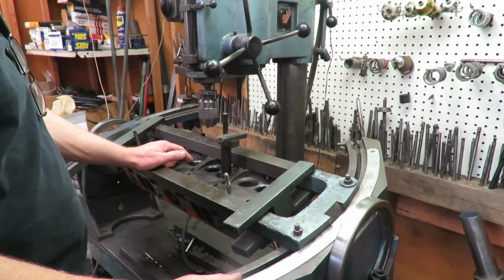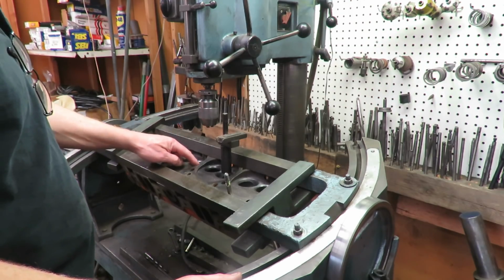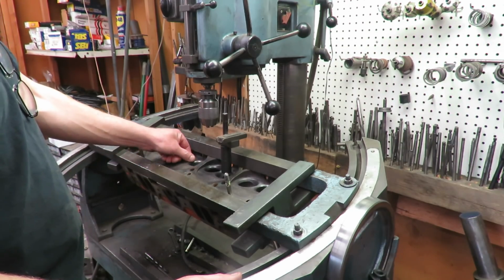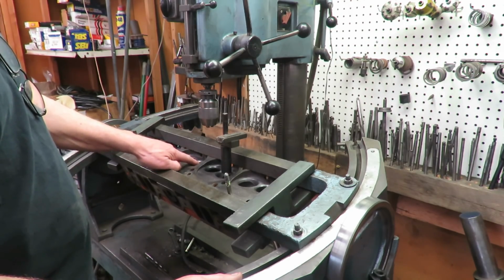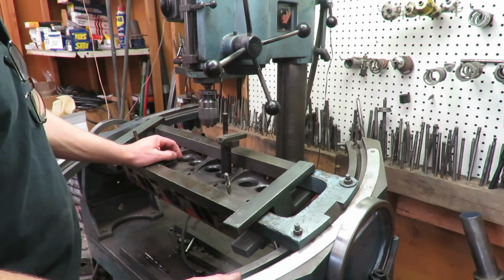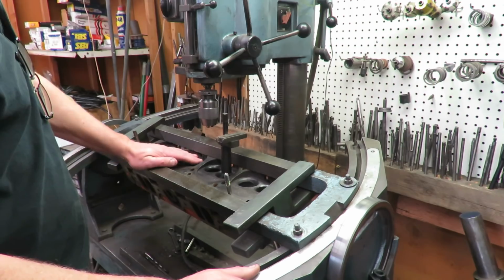If you've done enough cylinder heads, anybody that's done a bajillion cylinder heads knows that you can tell when you're cutting this area. If it's cast iron, when you put your cutter on this, it just goes through it like butter. When it's hardened, when you cut into this metal, you can actually see the hardened area. It's a different color, and it goes down about 1/8 of an inch even when you cut it. Like, for example, the 781 big block Chevys are the same way. So I think they're perfectly fine. I've never had any issues with them.